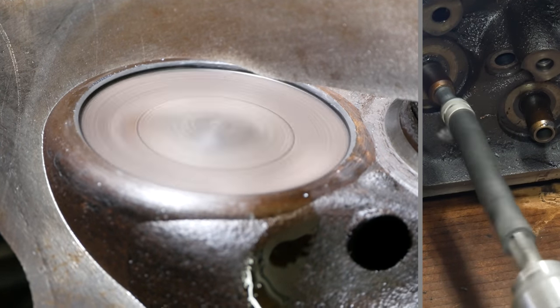Once it seems like we've got it all, we'll trade in the pressure washer for a brush and dish soap. This final cleaning pass should help get rid of any oils or abrasives that were left behind. In between the latherings, we'll keep rinsing everything off with the garden hose. We'll spend some time with the plastic bristle brush going over every side of the heads, and also use a smaller brush to clean all around the valve seats and the edges of the combustion chambers, and a plastic bristle bore brush on all of the valve guides. Then we'll give it one final, very thorough rinsing and carry it inside to dry it off. The blowgun attached to the air compressor will get it done, but we'll have to be careful to get every bolt hole and every little nook and cranny.